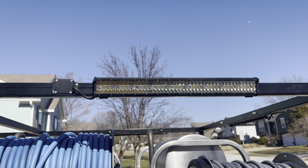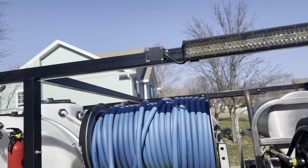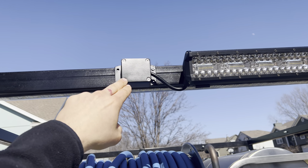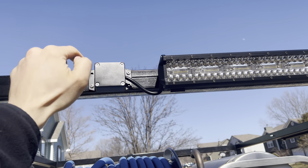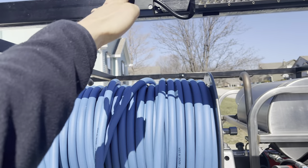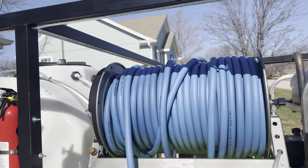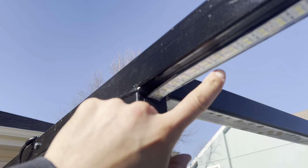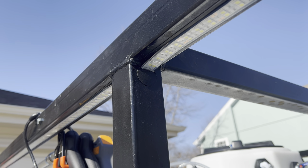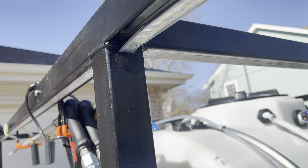These are 24-inch light bars, and all the lighting in this trailer is mounted in the frame. I was able to do that by utilizing poly boxes — metal two-inch waterproof boxes where the wire goes in and runs through the trailer. On the top of these I've sealed with sealant, and they're already waterproof so it's watertight. There's also a dual light strip here, and the hole is capped with a one-inch cap with the top cut off, making it real water-tight.